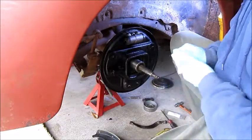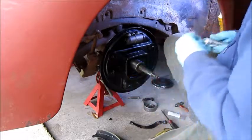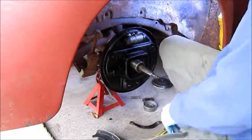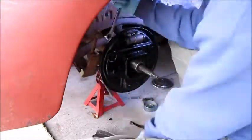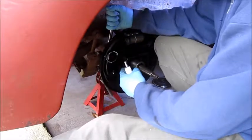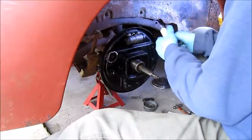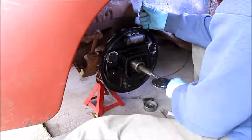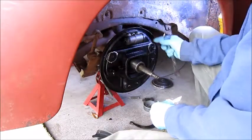In this video we are going to put the brake shoes back on and show you what is involved with that. Before I do that I am just going to put some white lithium grease on these parts here so that they pivot okay. Let's make sure they still turn. I'll leave it like that so it gets the most clearance. Do the same on this side. I'll leave it like that. Wipe off the excess — that way there is clearance for the brake shoes.